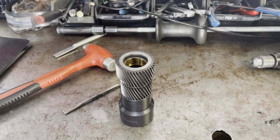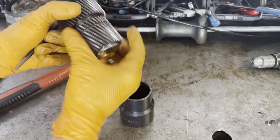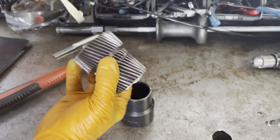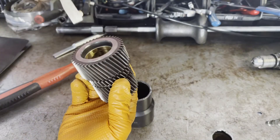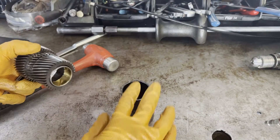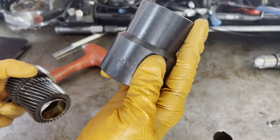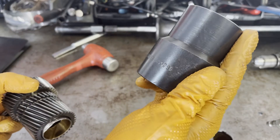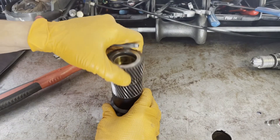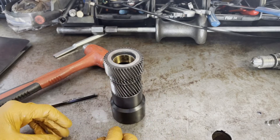Here's how I typically remove these sun gear bushings. Take a small chisel and work all around with the hammer on the bushing closest to the surface, on the side of the gear. All the way around, I'll support it with the Miller tool 990799, and once it's out you can use a bushing driver to pop out the other one.